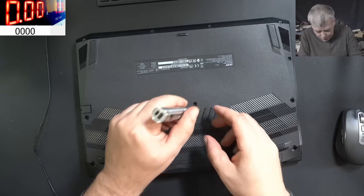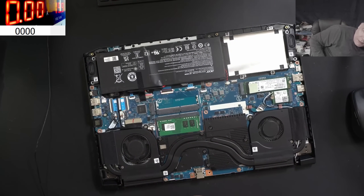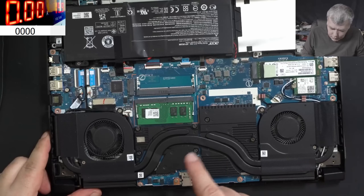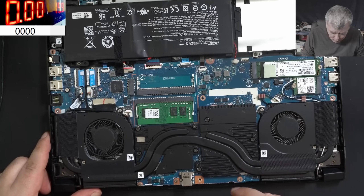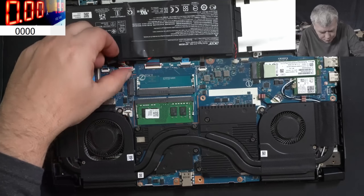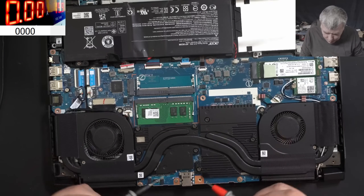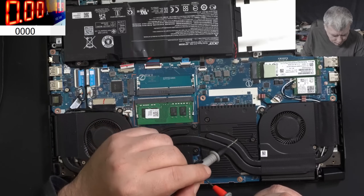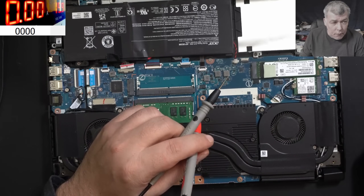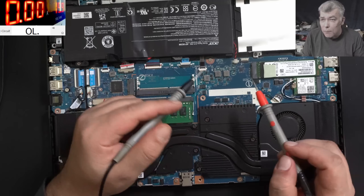Most likely we are going to have a surprise. The laptop is open - this is a nice motherboard. Can you spot any fault here? This is quite a different design. It's not old because it has RTX graphics, but usually we can see the input circuit here, and not on this one. I will unplug the battery and we're going to check the main power rail. Checking the capacitors - zero ohms. Main power rail is shorted.